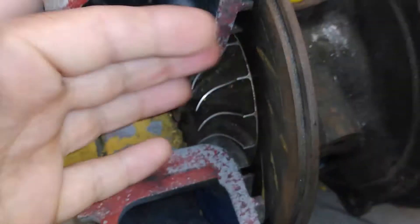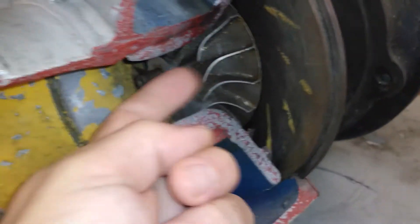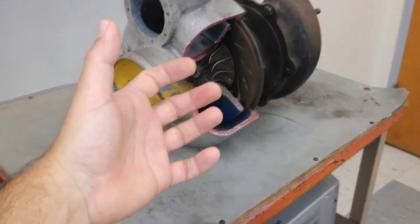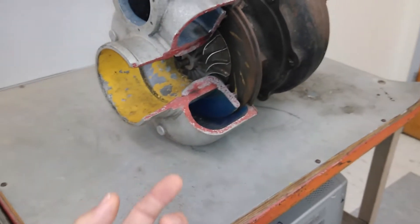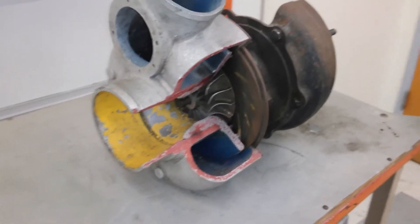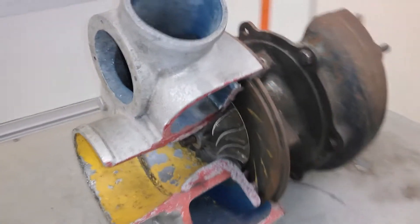It's not very intuitive at first, but once you see how it works it makes all the sense in the world. These blades grab the air as it spins, pull it in, and fling it out to follow the housing in a swirling motion — just like if you create a vortex in an empty soda bottle: fill it with water, turn it upside down to drain it and it glugs and bubbles until you spin it, then you get a vortex going. That's a very efficient way to make a fluid flow, and that's what we're doing here — creating that vortex to create better flow through this housing and out to the engine.